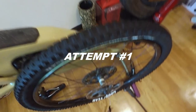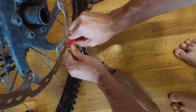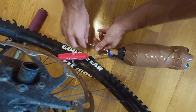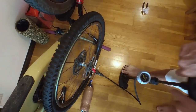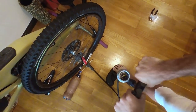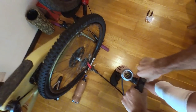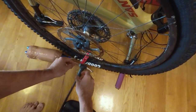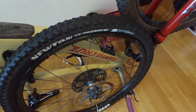Let's try the DIY inflator. No pressure in that tyre at all, not seated. Let's close the inlet with my special tool. Okay, inlet closed. Attach the pump and start building some pressure in the bottle. That's 80 PSI in the bottle — don't go any higher than that. Leave the pump attached. Three, two, one. Nope.